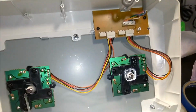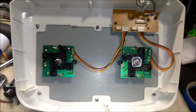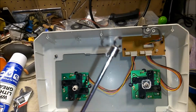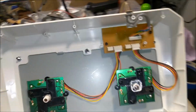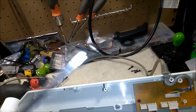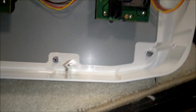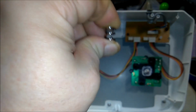Like I said, you're going to want to hook this in here, basically, and gently pull it out. And then you can remove your actuator and start pulling it apart to disassemble and clean. Okay, so after some careful prying, we got the C-clip off, or the E-clip. I call them E-clips. It looks like an E to me, but the internet. I went ahead and pulled that off, and I like to keep track of it with my magnetic grabber. And then here you have your actuator, which you can pull off, if you can pull it off one-handed. And then you have the evil holy mother of springs. This thing is insane. I'm pushing as hard as I'm able to, and it's not budging.